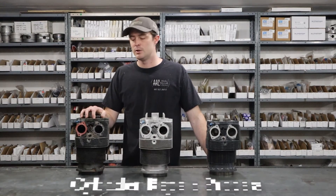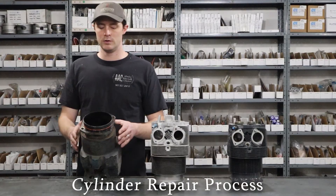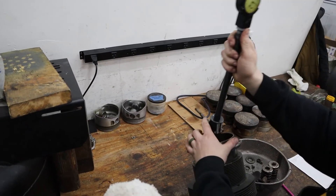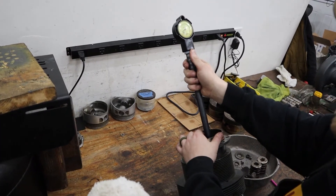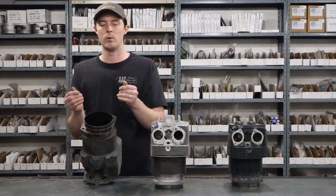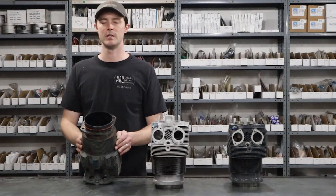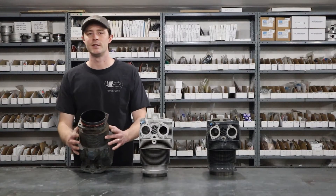What we do is get the cylinder in here and disassemble it. When we're measuring the bore, we have a dimension for the first several inches, but we also want to see at the top near the combustion chamber if the cylinder bore is tapering and getting tighter — that's what we call choke. We want to see a specific amount of choke in the cylinder, and we have new limits and service limits that we're allowed. So after we've measured the cylinder bore itself, we'll go back to the valves that we took out earlier.